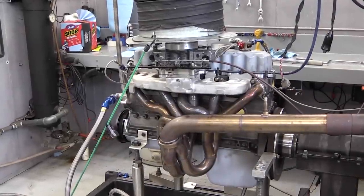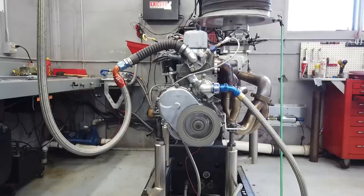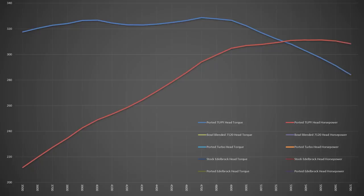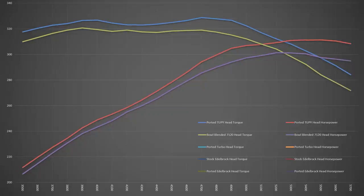As Newcomer mentioned, the second head is an older style with a larger exhaust port; otherwise it's mostly the same. The big difference here is that the ports haven't been touched — the only hand work done is to blend the transition from the valve seats to the bowls. It's not surprising that the unported head suffered in comparison to the ported one. Interestingly, peak torque only fell off eight pound-feet but dropped way down in RPM range from 4,700 to 3,900 RPM. We also lost 10 peak horsepower and 7.7 across the average. Still, considering this head has received only basic machine work — decking, new valve seats, bowl blending, and some cutting of the spring seats — this is pretty impressive production for an economy-level cylinder head.